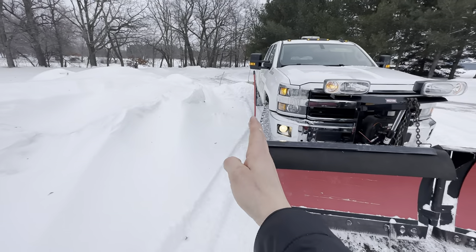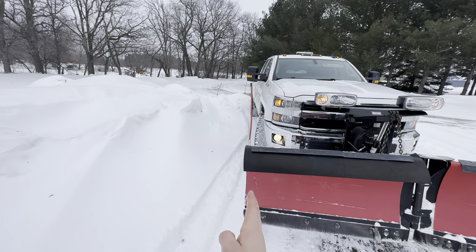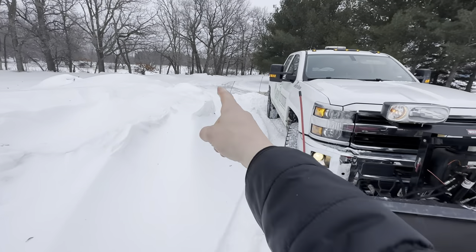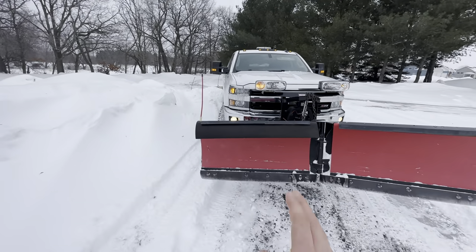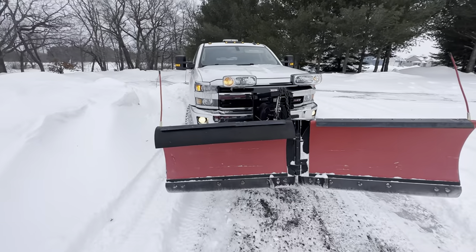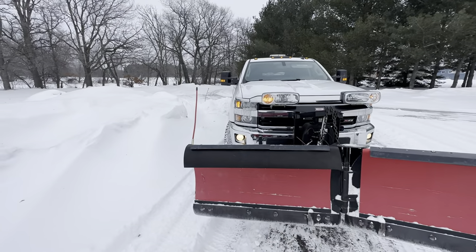When I'm going along a building with this plow, see how it aligns with the mirror — that means if I'm plowing along a building my mirror has to be basically on the building. With an F14, F12, or Western Wide-Out it gets out farther, so you don't have to have the mirror right on the building. With this back plow there's things I'll never go without again. Yes you still need a front plow, but there are so many benefits to a back plow or a wider front plow.